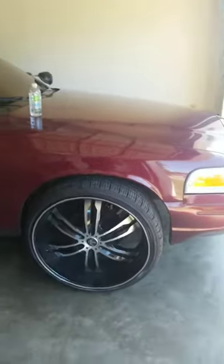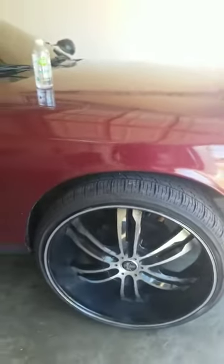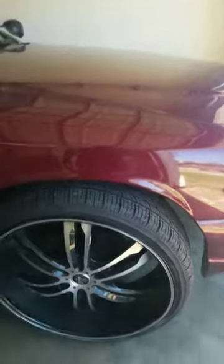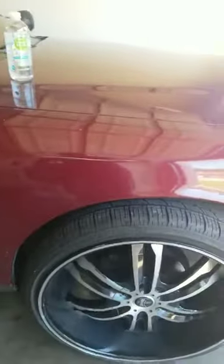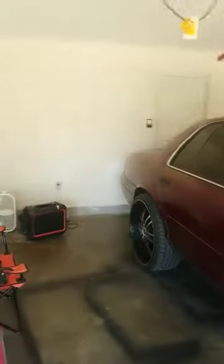2 packs of the big knuckles, the rear knuckles, put them in the front. I put 4 on each side. Some people go with 2 on each side. I just want to be sure I got it up as high as I wanted to. Like I said, if I go 6s, I can go 6s, no problem. I don't have to do any additional lifting or nothing. But it's set up, and it gives me a good ride.